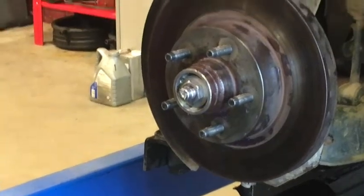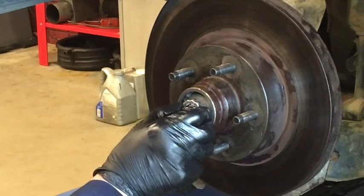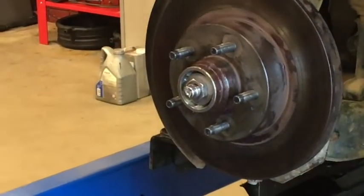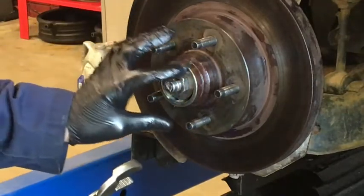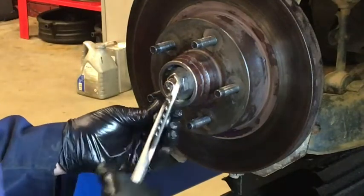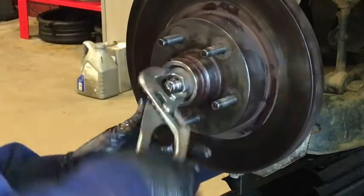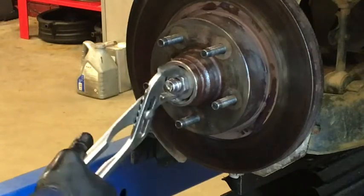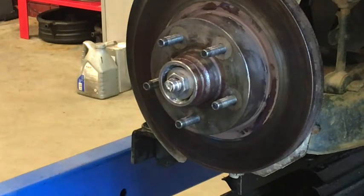At that point we're ready to put the castle lock on there and put the cotter pin in. Now I want to show you an alternate method. If you don't have a torque wrench handy, a lot of experienced mechanics will get an idea of feel on a bearing. Remember the goal is not to put a lot of load on that bearing because you're running grease — it will cook the bearing from overheating. So the goal is to just take the play up, add a little tightening, rotate it, back it up so it's totally free, and just feel where the play is gone. You'll feel it come to a natural stop, and then just a little tiny bit of extra force — not a lot.